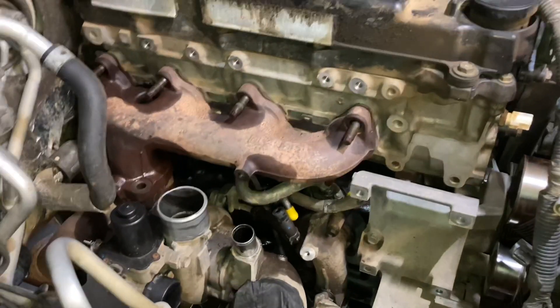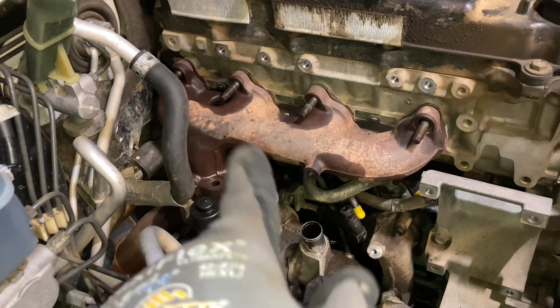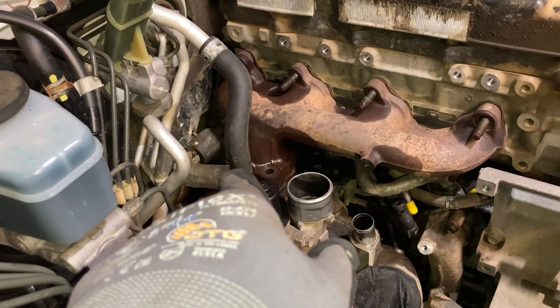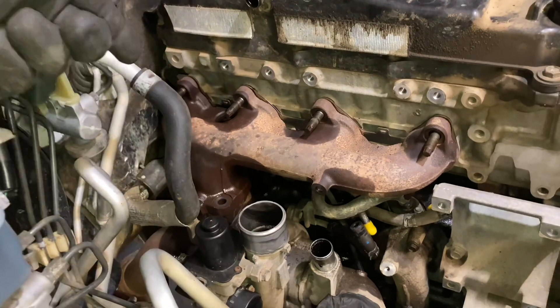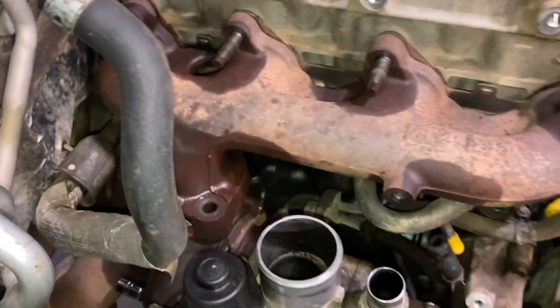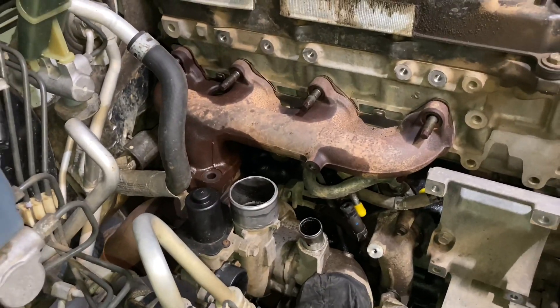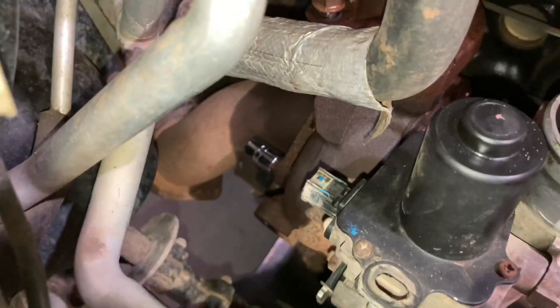Up the top end of things, everything's gone to plan B. Disconnect the battery, get the compressor out of the way, pull the dipstick out. We've got the three bolts out joining the exhaust manifold to the turbo, no problem. We've got to get the studs out. We've got the 17mm - the coolant line to the turbo down there we've got to get to. We need the manifold out of the way to be able to get to it. It's down there, hard to see. So we'll remember to get that socket and everything's going to plan so far.